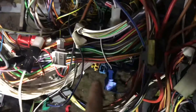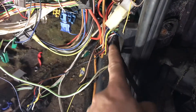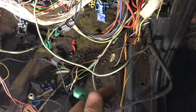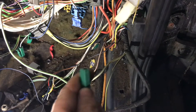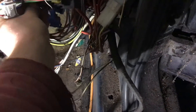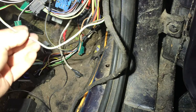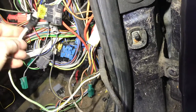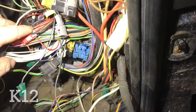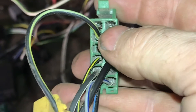D is way up here with the yellow plug just here. Following this wire, it actually goes into the door for electric windows — so the yellow and black wire with a green plug goes into number three of D, which is D3, to power the electric windows. Since we're in here, we'll also follow this green and white wire from this black plug into this white plug, joined down at black K12. So that's D1, D2, D3 — which we've just used.